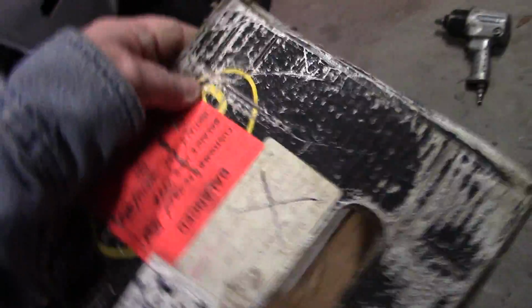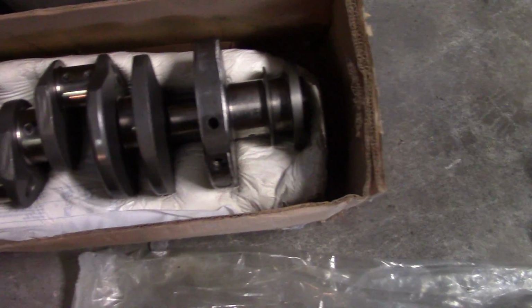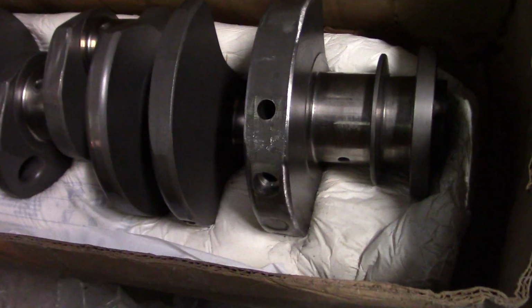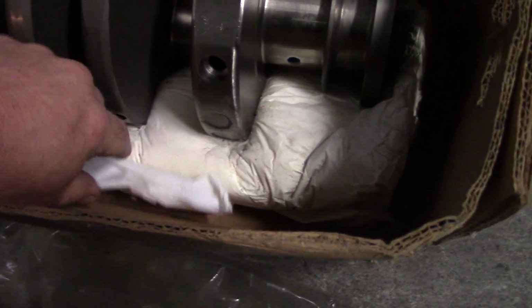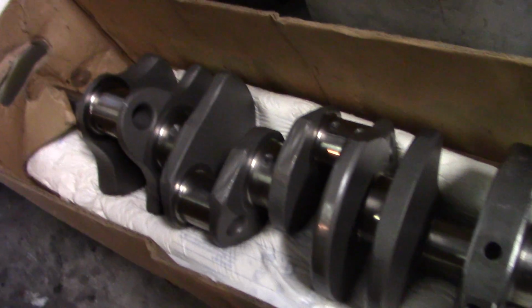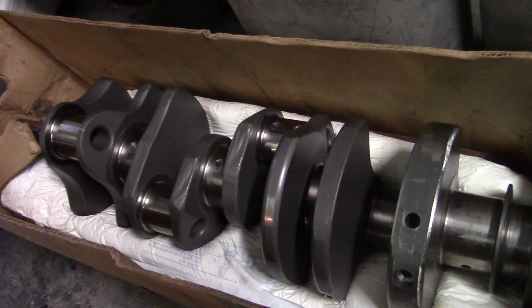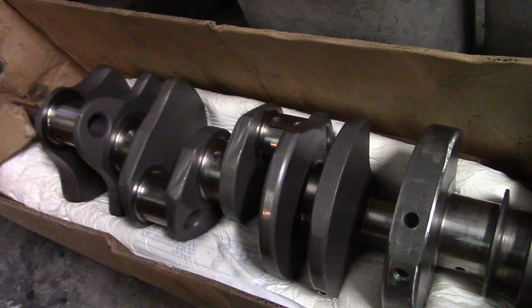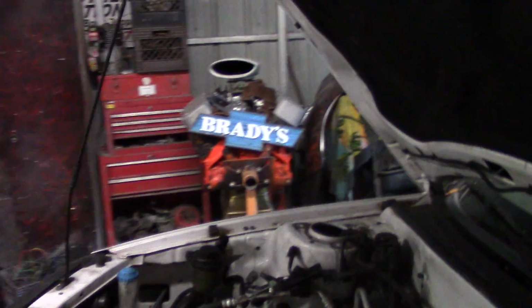And this crank's only got 200 passes on it, I think. So it's still standard, never been blown up. Have you guys ever used one of these before? They're like indestructible. It's had the Mallory welded in it, so it's already been set up for the bob weight there on the box, which would be a 509, and that wouldn't be bad. So if they can help me out with a block, we might incorporate this instead of the 454 over here.